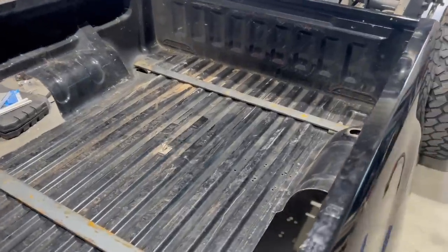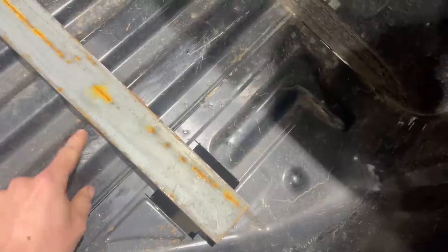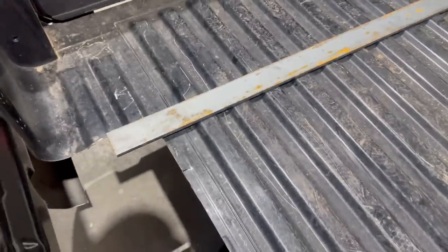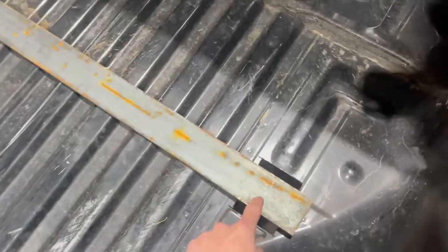So this is what we got up to last night - basically I did a cut-out here where the tray mount is going to come through, and another one on that side. Now instead of mounting underneath the tub itself, it's going to come through and sit under this once I've welded it. Because of these ridges, that's going to give it about 20mm drop, so the top of the tub should come down 20mm. In the rear I've cut out where it was originally mounted - you can see the difference in height. I've got these all centered and now I'll grind back a bit of this paint and do little stitch welds on each ridge along both sides the whole way, then just drill some holes and bolt them in.